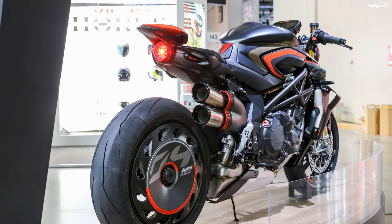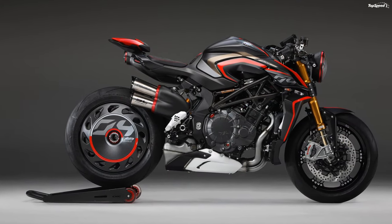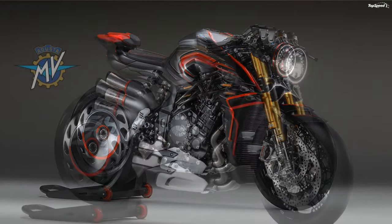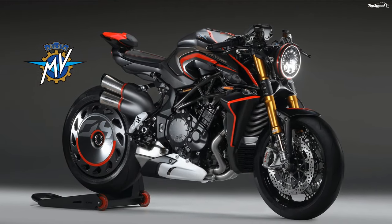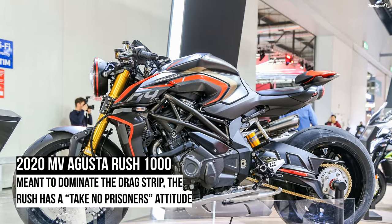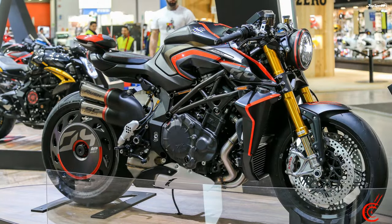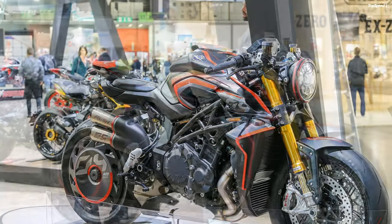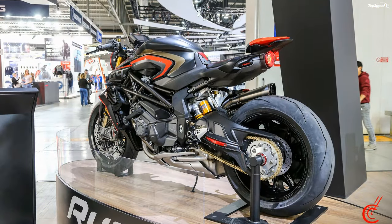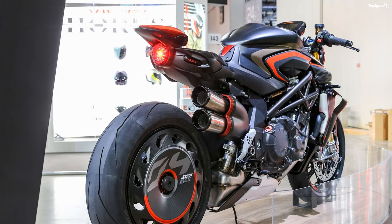An Eldor EM2.10 engine control takes care of business and delivers a handful of safety features such as a 4-map torque control, 8-map traction control, and anti-wheelie system. The 6-speed transmission comes stock with the electronically assisted quickshifter that lets you work your way both up and down the range without ever touching the clutch or rolling off the throttle for blistering acceleration. A slip and assist clutch couples engine power to the gearbox and adds another layer of safety to the mix.